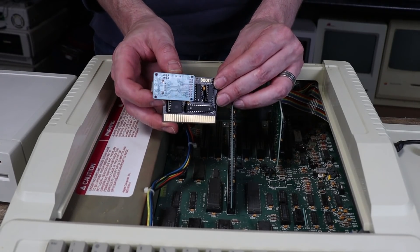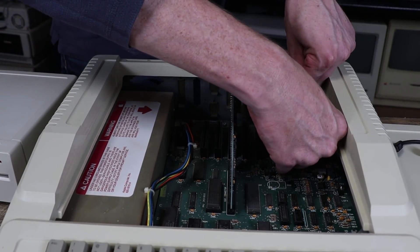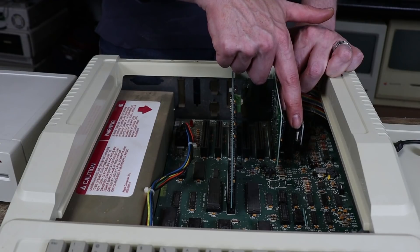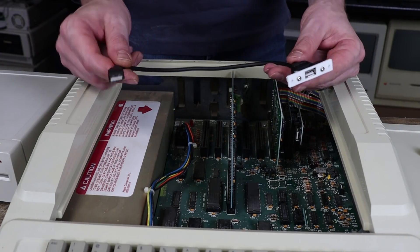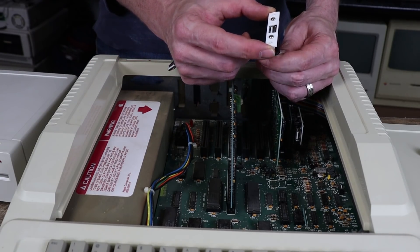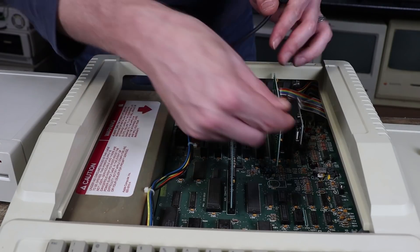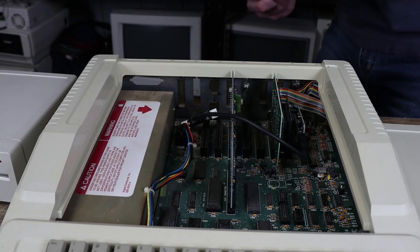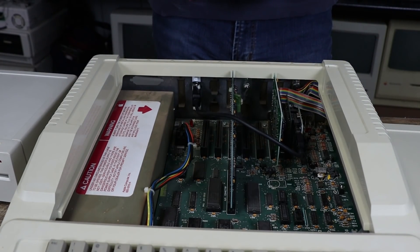Installing this could not be any simpler. All you've got to do is make sure that the USB port points towards the keyboard, and it goes into the highest slot available — in this case I believe it's slot 7. Normally you would simply stick your thumb drive in here, put the lid back on, and off you go. But I'm going to do one little extra thing, and that is I found a panel mount USB from a previous project. I knocked together a little adapter plate which goes into one of the DB25 slots on the back, so you can get to the USB port. And that's it — that is the hardware installed.